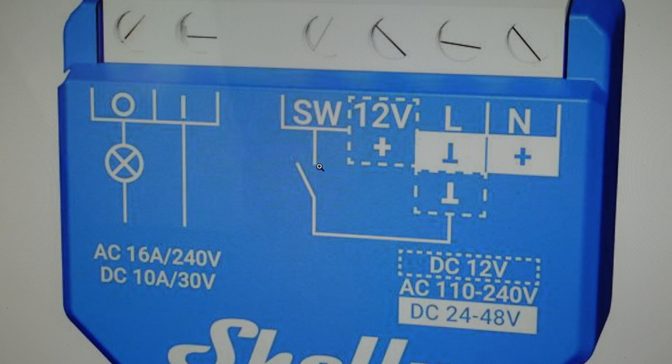We'll know if it's worked correctly because during the factory reset, the LED will turn solid green for about a second, and then the blue and red LED will start blinking in mode three for about two seconds. The blue LED will be blinking in mode one if the factory reset is successful. Once that happens, you can go ahead and set it up as a new device.